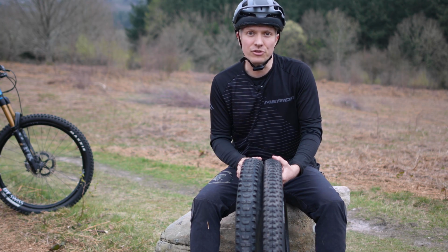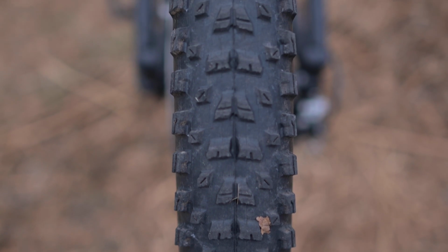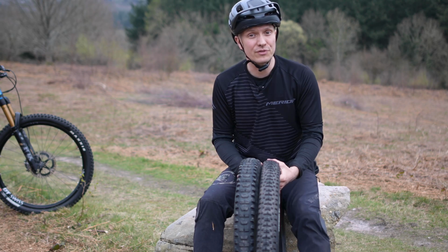Tall, broadly spaced knobs will squish about as you're riding, and again the rubber will absorb that energy through hysteresis and turn it into heat. Having more closely spaced and lower profile tread will reduce that from happening, but once again the trade-off is that spiky, knobbly tread grips much better on soft or loose surfaces.